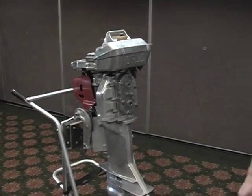The two most difficult motors to do are the OMC-A and the Mercury 15 because their spark plugs are on an angle. That requires at least 2 to 3 people. 3 is preferred. One holds the flywheel in a stationary configuration. Another person holds the power head, and the third person does the CCing. And in that process, you would put the engine initially, as we did here, in a horizontal position with the spark plugs being on the angle.